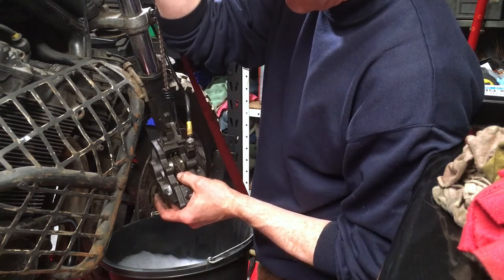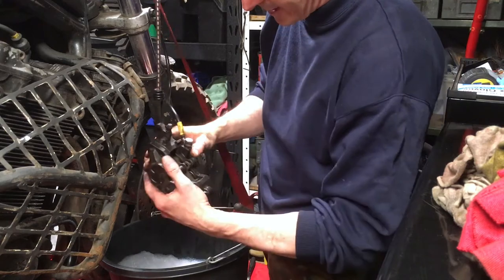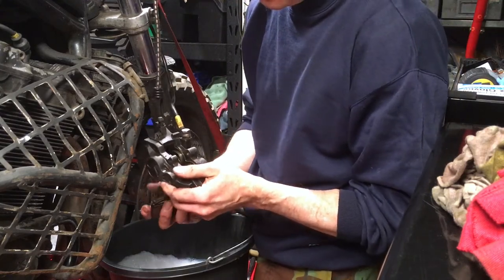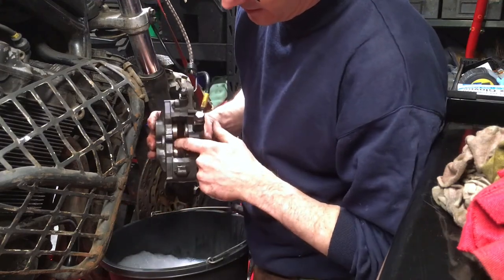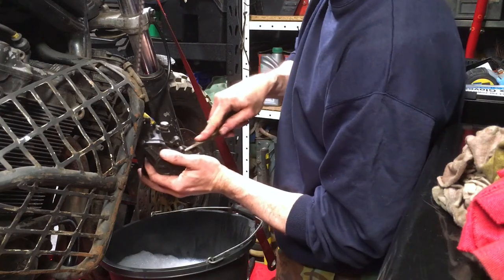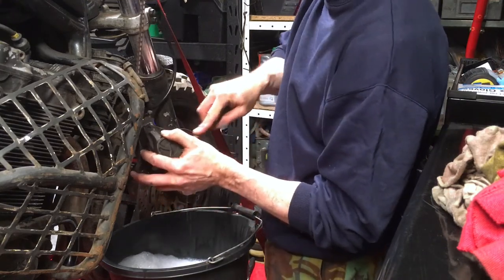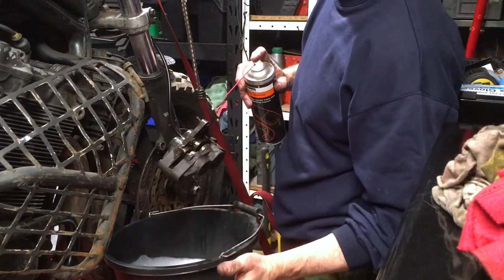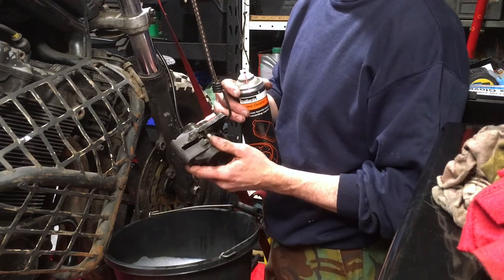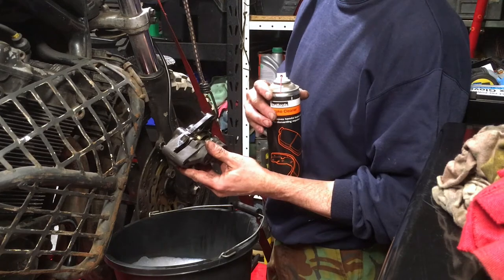You can just pump them out with the lever, because they will all come out at different rates. Then you can get in there and clean a bit more. If you push the pads in a little bit, you'll be able to wiggle them out, and more of the pistons are exposed so you can clean more dirt out of the way. Remember that the pistons will move out at different rates — it's perfectly normal. The fluid comes in at one point, puts more pressure on one piston first, then another, then another, and finally the last. It's just the way calipers are designed — it's just physics.